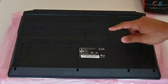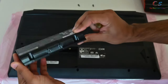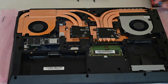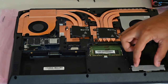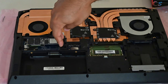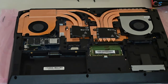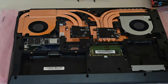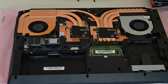To get to the bottom panel, you need to remove a few screws. I also recommend removing the battery when working on the laptop. With the battery removed, the bottom cover just comes right off, and here we have our beefy looking heatsink. There is a 2.5-inch drive bay for SATA expansion, and there are two M.2 slots for further expansion. We have two RAM slots — I'm running 3200 MHz memory right now — and then we have two fans on each side. This is the GPU, and this beefy side is the CPU, so the CPU can be removed.